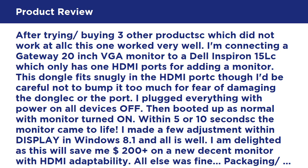I'm sure there are some adjustments I can make to fix this, or I can just plug in some external speakers through the 3.5mm jack port. Follow-up: I fixed this by going to Device Manager > Sound, then right-clicking my laptop sound device to disable it, and immediately re-enabling it. I then disabled the device showing the monitor speaker and left it disabled. I now have sound again through the laptop speakers.